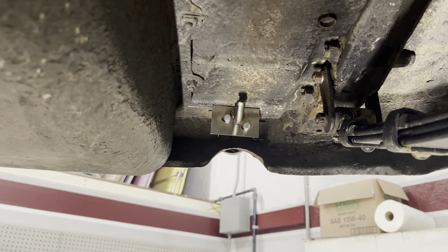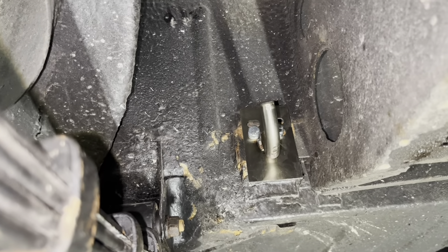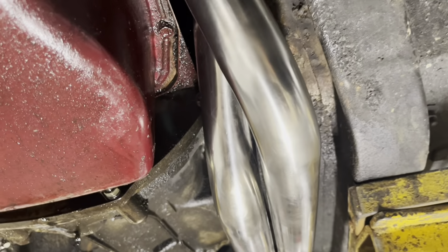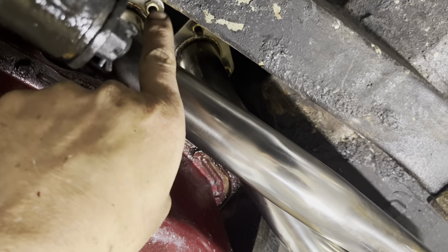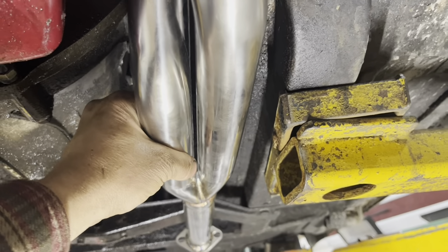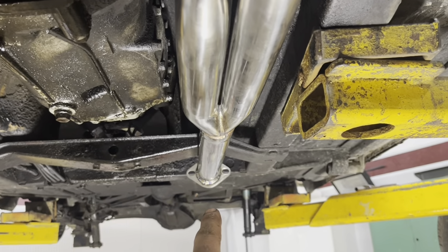Now I've got that one installed in the back and up here in the middle, so we can start by hanging the front pipe. I didn't film actually putting this in place because it's almost impossible to get the camera up in there and see what we're doing. It comes with gaskets, but it does not come with new nuts — so it's a good idea to buy all new brass nuts when you buy the system. Get it on there where it just barely moves a little bit, not fully tightened yet, and then we'll hang the second section.